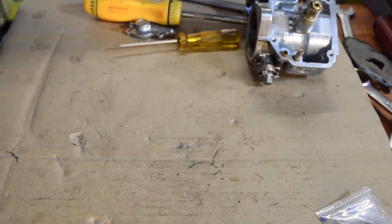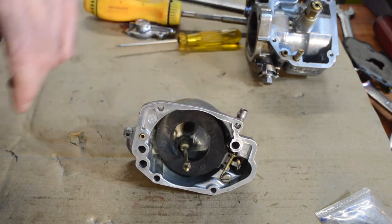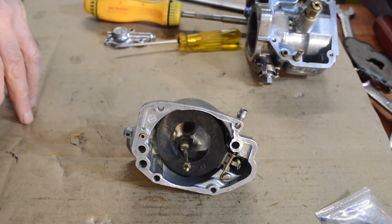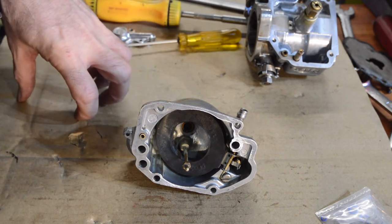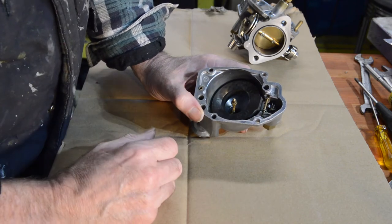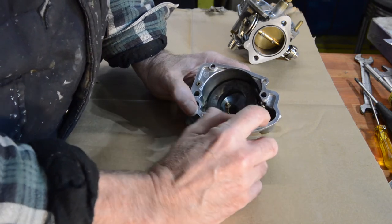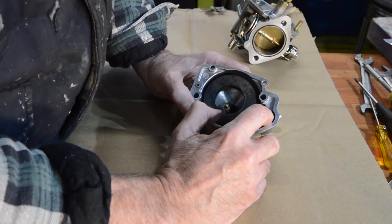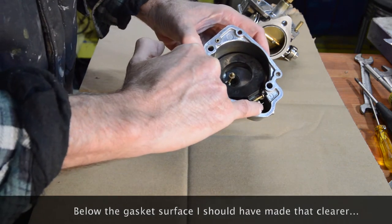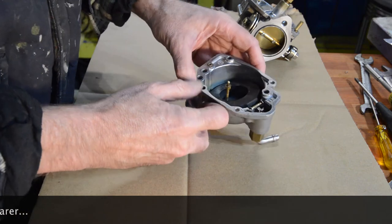So it's float height - I haven't got a figure for that, I'll have to look online for the S&S spec, which I should have thought about before pulling this to bits, but I just decided on a whim to start this. Right, I've had a quick look at the S&S website - it should be an eighth to three sixteenths of an inch. With the float valve shut and without compressing it too much, I measured it and it came to just about an eighth of an inch, so I'm quite happy with that. If you need to change it you just bend the tang up or down to get the correct float height, but I'm happy with that.